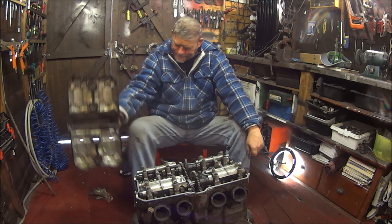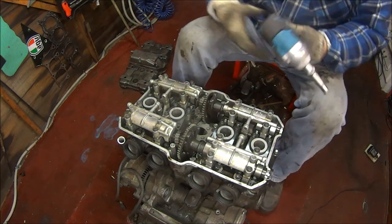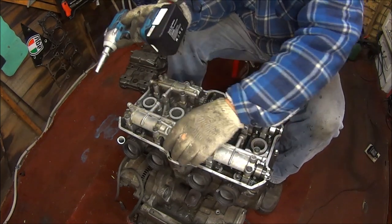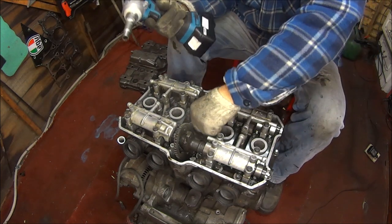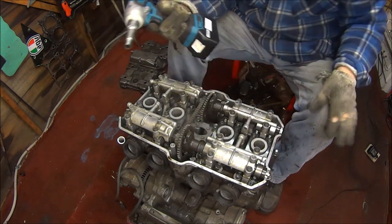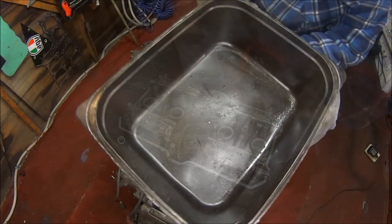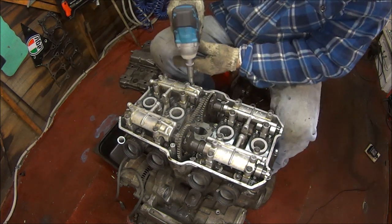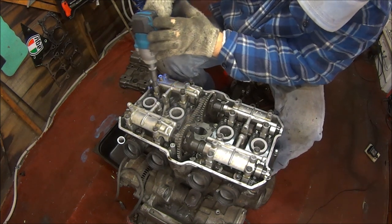What I got for Christmas — I think all these bolts are loose because back in the summer I did take the cam chain tensioner out and check it. Checking the cam chain, it feels all nice and loose, no tight spots. So let's whip these off into a suitable container. Yep, they're all loose.